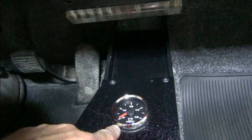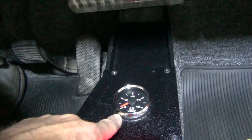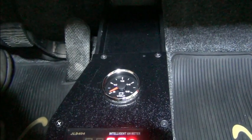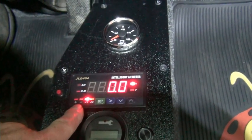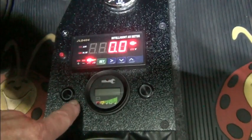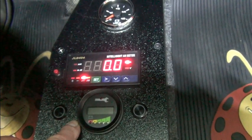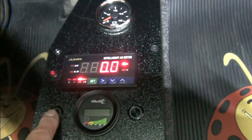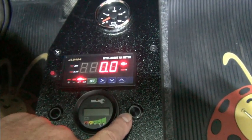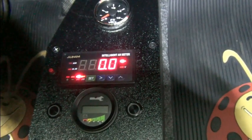We always include a 12-volt gauge so we can monitor the 12-volt and charging system — and I mean the DC-to-DC converter, which maintains and shares the load with the 12-volt battery. We have the JLD 404, which monitors our battery pack. We have the Curtis 840 display, which monitors the motor and controller and is also used for programming and diagnostics. This is the menu switch, which allows you to scroll through the settings. This is our electronic reverse, and this is your system-on switch. When you turn on the ignition, this green light is just a reminder that the system is energized.